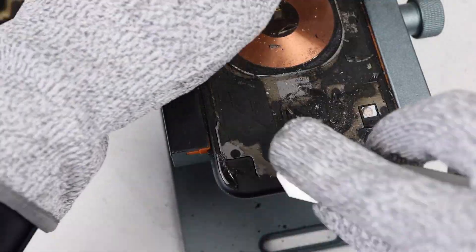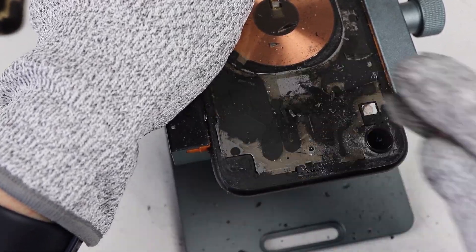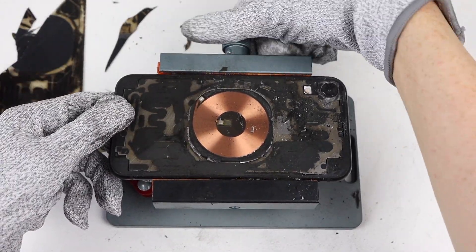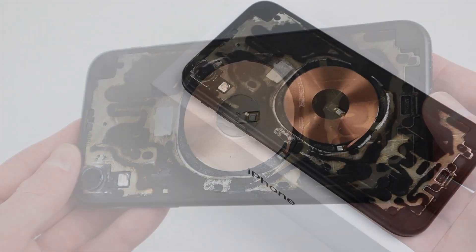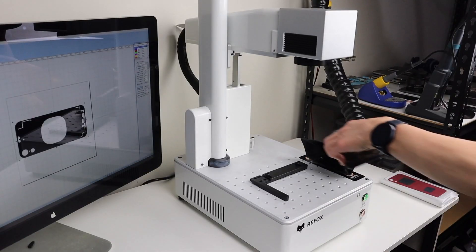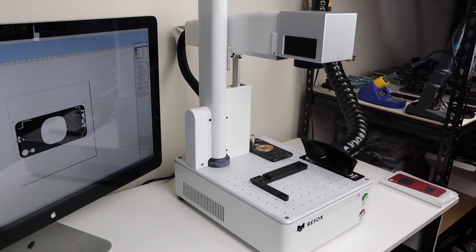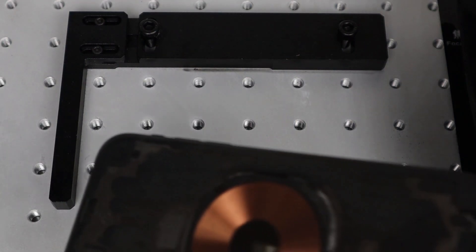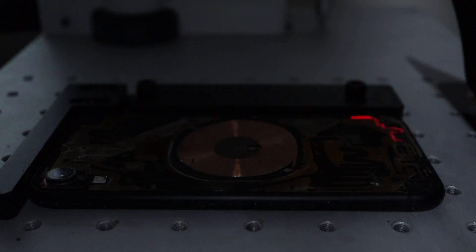Even so, we'll still need to make sure to remove all of the old glass to make sure the new one fits on nice and flush. With the glass removed, you can see there's not much underneath — just a whole lot of metal and the wireless charging module. While all of the glass has been removed, there's still a fair bit of adhesive left, so we'll need to place the phone back onto the laser machine for another run. I will refocus the machine and give the phone another go, slightly modifying the template to make the space around the LED flash wider as the laser previously clipped the edge of it.